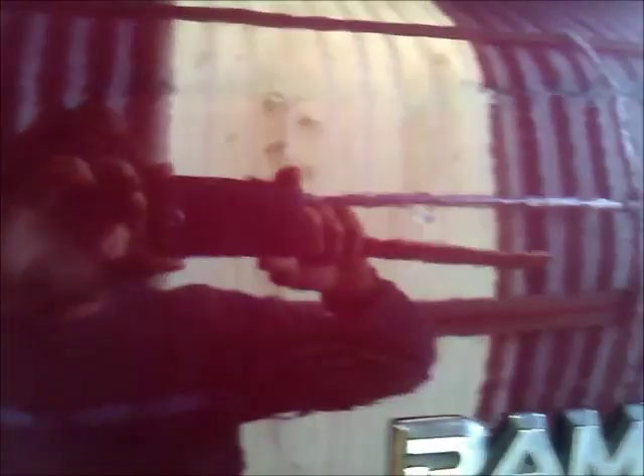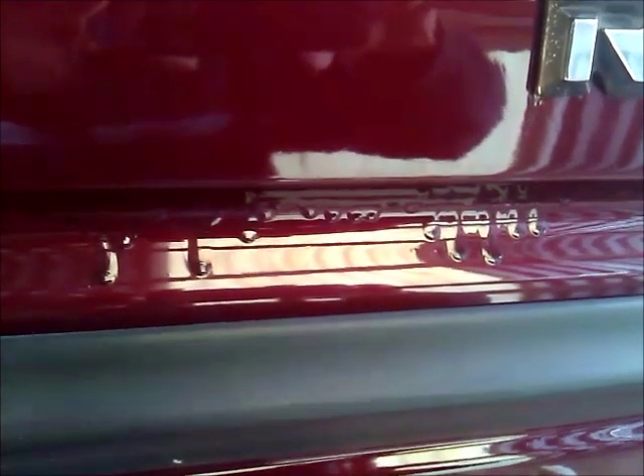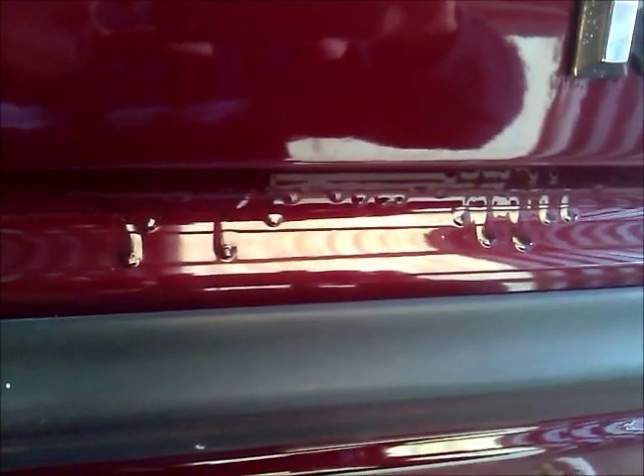It's real hard to set your spray gun adjustments. The professionals have a paint booth and they leave the settings the same all the time, so it's a little harder when you have to do it yourself. I'm going to sand these down and then show you the buffing process. First I'm going to do 320, 500, 1000 — and you don't need a whole lot of sandpaper.